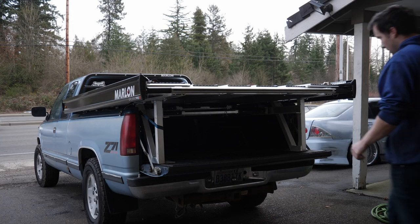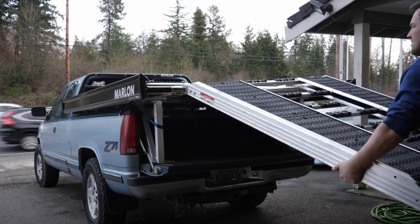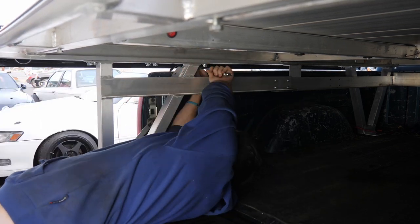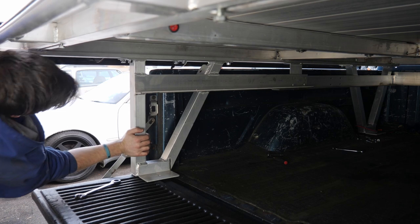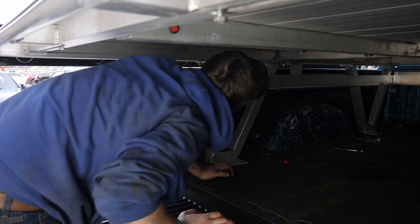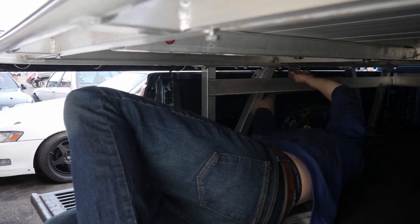To accomplish this, the rear legs of the deck can actually be moved inwards to the short bed position. You will need to remove the ramp in order to do this — simply slide it out and then slide it on top of the deck. This is done by loosening up four nuts where the leg attaches to the deck, then removing the four bolts along where the ramp slides in, and lifting up slightly on the deck and pushing back on the leg. Then just replace the four bolts and tighten up the nuts, and you're all set.